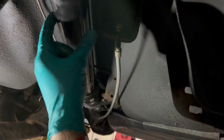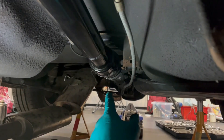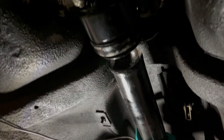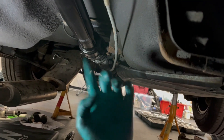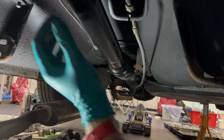Under here I've started fitting the prop shaft - I've replaced it. The original one, when you grabbed the input end and the output and rotated it in your hands, you could feel play in the joints. This one is out of a Vitesse but it was a low mileage one, and there's minimal play, so hopefully that should reduce the feelings of backlash. It's not backlash because the diff's good - it's driveline slop, basically.